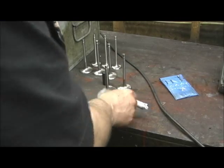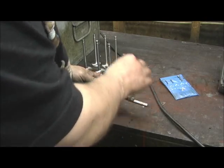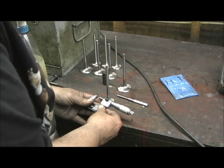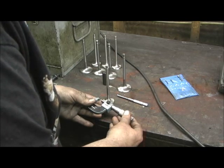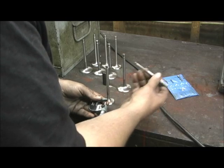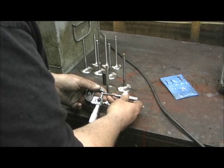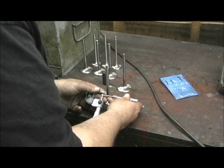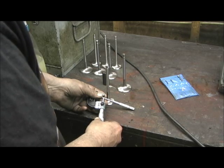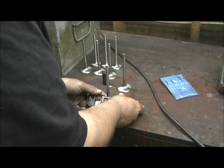In setting the gauge, typically what I do is I'll measure the stem. You have to do this separate on the exhaust and intake because there's going to be about a half thousandths difference. I'm coming up with .3420 exactly. Then on the exhaust I'll add about a thousandths and a half — 1.5 clearance. I've already set the gauge but I'll show you the procedure. I go in and get where it's barely got a snug — there we go, that's about 1.6.